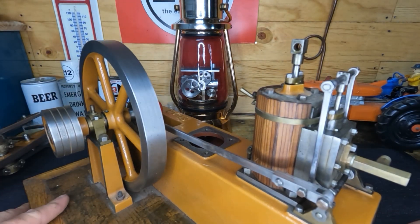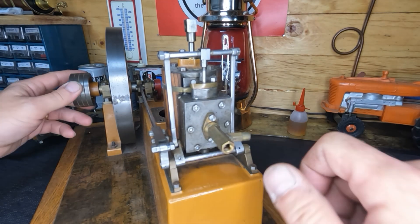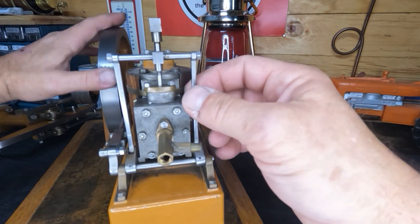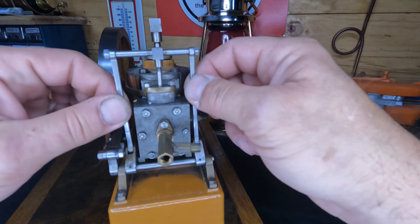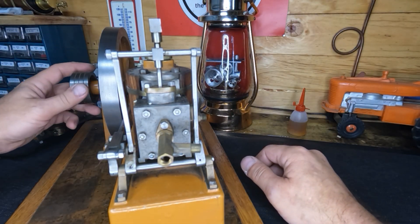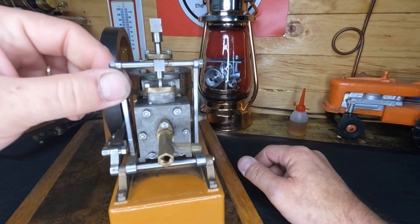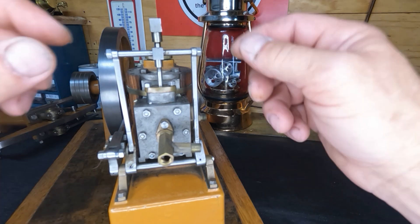Just by looking up here in the front — by turning this over, can you guys pick up the play that we've got right here? You see that? So these are just roll pins put through there. That's going to need to be addressed — that will be a problem when it comes to getting our valve timing set properly and getting it to repeat every time. We do have a free range of motion, but yeah, that's something we need to address. That's not right.